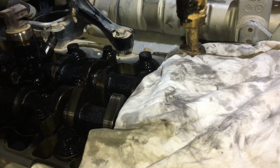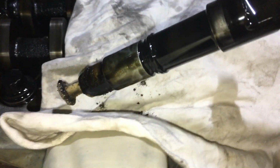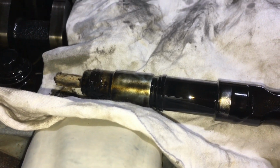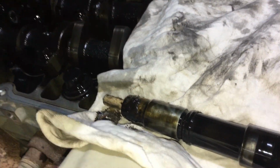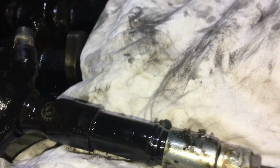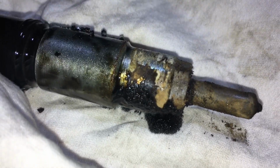As predicted, right? Now, can you please lay that down for me, mate? That's it. Perfect, because this is no surprise to me. Did I not describe, go back to the start of the video, the problem you had was because you held the injector standing up too long, or it all ran down, right? So what we should have done is laid it down more quickly. Let's have a look at this side. If you stand the injector up too long, you can see all the oils run down.